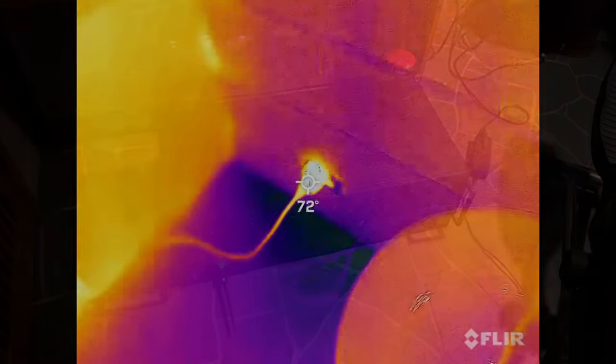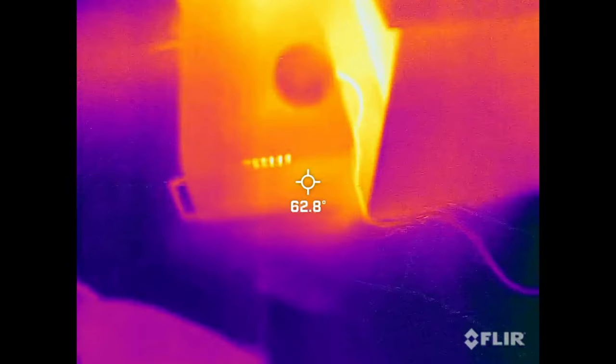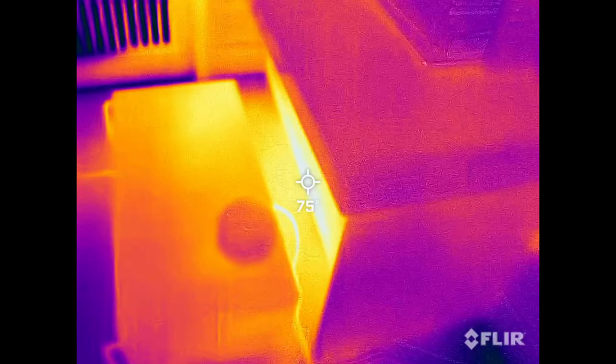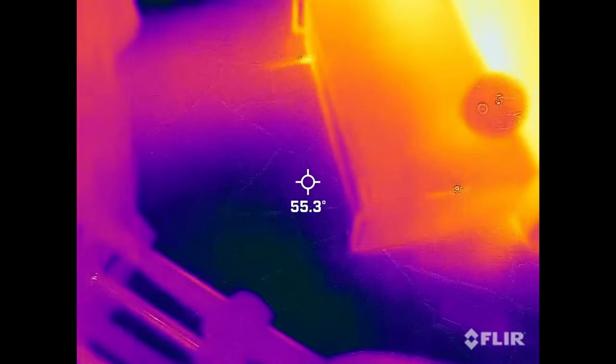And the other rig is doing pretty well, just sitting over here too. I'm noticing we're right on the edge of Wi-Fi reception, so I actually had to push the antenna outward to get the thing to link up and accept shares, but this is pulling about 900 watts on 120, and it's doing pretty well. So pretty good. Smart plug's at 72 degrees Fahrenheit. Not bad. 75 degree exhaust. And yeah, it's cold down here, 56, 55 on the floor.